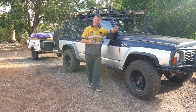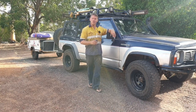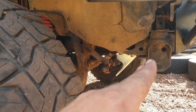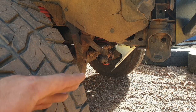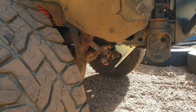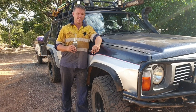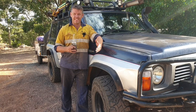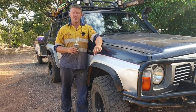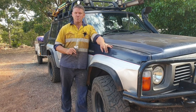I'll put the link in the description of where I bought it from just in case you're interested. If you're wondering how the air dam works: air goes through the radiator and through your shroud, and the angle of the dam creates a vacuum at the bottom, drawing all the hot air out of the engine bay down and out. I found that when you started coasting, the temps would drop - not super quick, but you'd see them come back down again. It takes less than five minutes to fit, as long as your bolts aren't snapped off. For $115 you've got nothing to lose. Hopefully this video helps if you're thinking about doing it - results may vary depending on your setup. Take it easy.